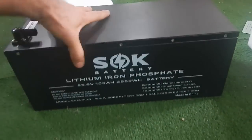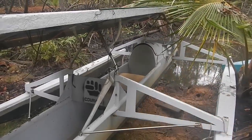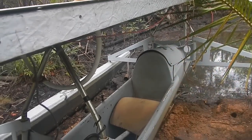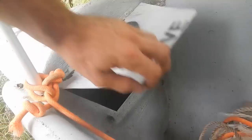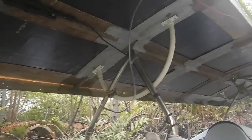Alright Jamie, let's figure this out. Got this mighty sweet battery here and a boat that's begging for power. So where does everything go? I sit right there, the motor's in the back. I don't want to put the motor and the battery in the same place. My first thought is to stick the battery up through this hatch - it's definitely long enough, the hatch is definitely big enough. And where do I put the charge controller? I'd like to be able to see the little blinking lights, maybe attach it to the ceiling somewhere up here.